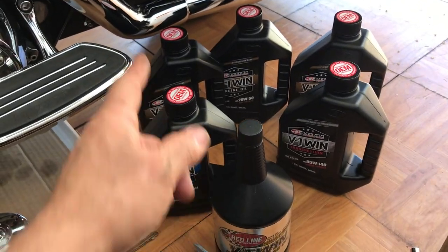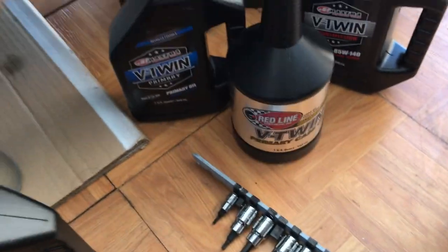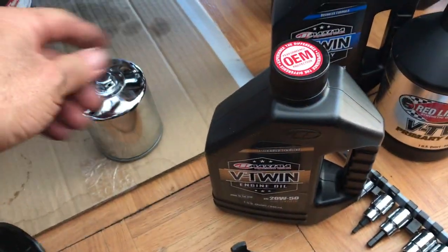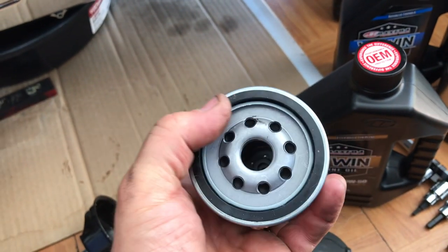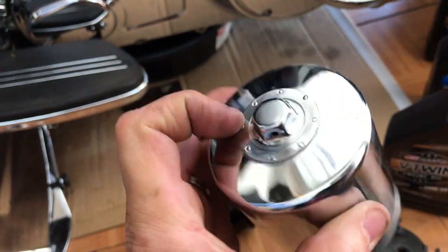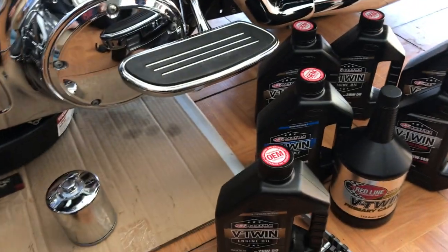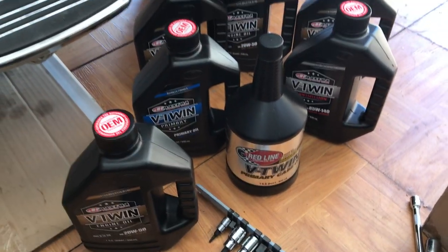I'm using an oil kit, so it comes with oil and primary fluid, and then I got a little bit more primary because you need a little more than a quart. For the engine oil, put a little bit in the new filter — you don't have to soak it, just put a little in there — and of course put a little around the gasket before you put the filter back on. I have this type of filter which I recommend because it makes it really easy to remove with a ratchet, so you don't really need one of those filter wrenches if you have this kind of filter. We've also got our transmission fluid over there — you can look up what kind of fluids you want to get.